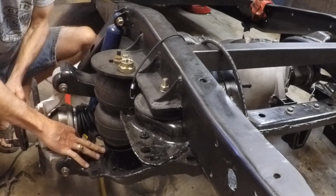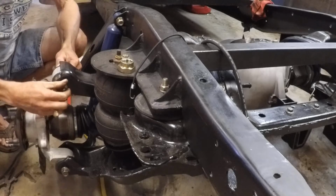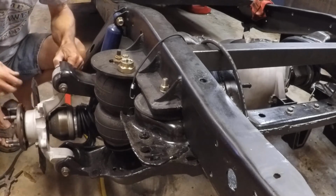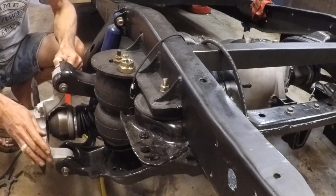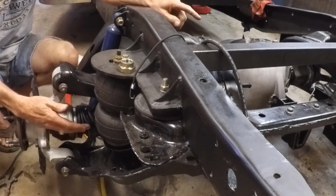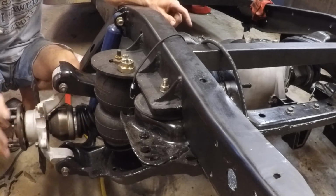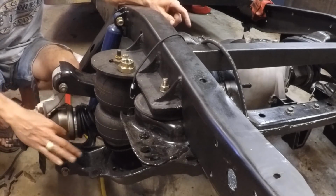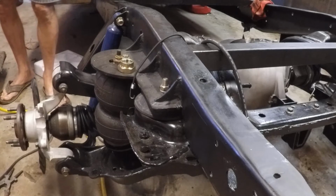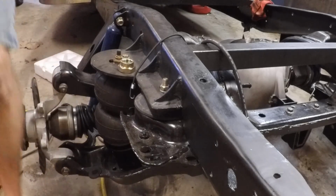Let's get on with it. Next thing we're going to do is go ahead and assemble the brake drum, brakes, Ebrake cable, all those goodies. I may have mentioned it previously. I did take the aluminum backplate for the differential and the two knuckles and sandblasted them, and then covered them with some matte clear just to keep them from oxidizing. Hopefully keep them looking half decent when we get this thing dirty. Right, on to other things.